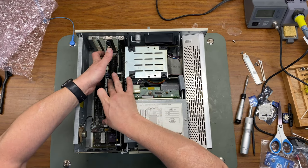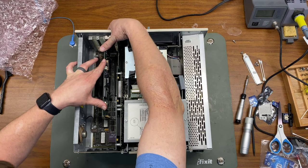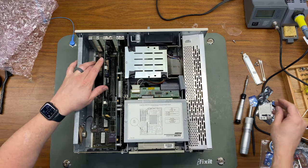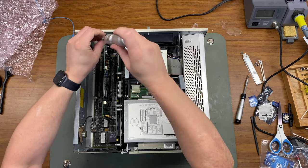And of course, any good retro computer is going to need a sound card. So I'm adding a Sound Blaster 16, model CT2230, which is a Sound Blaster 16 that does not have the hanging note glitch and also still has a real OPL3.